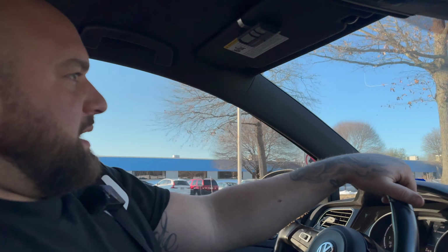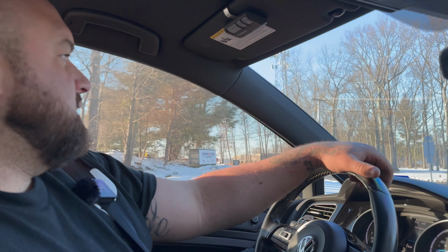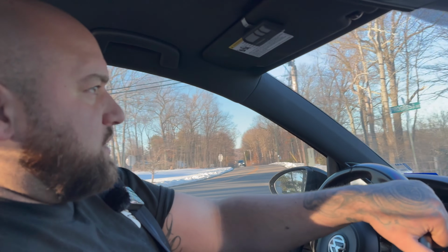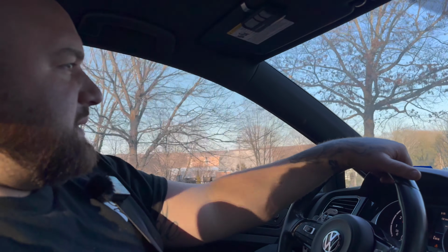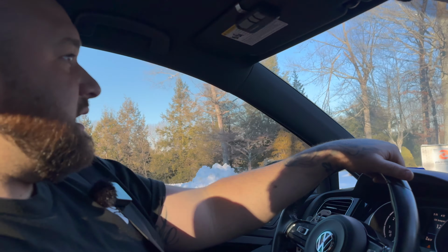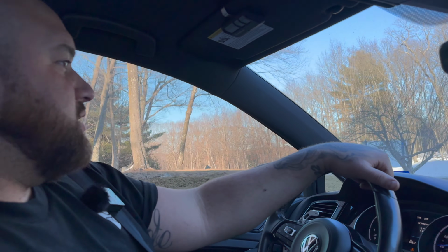The high-pressure fuel pumps on these, when you have the aftermarket piston in it, sometimes when it gets hot, the piston seizes up. Right on the last runs, Matt over at EQT said fuel pressure just is bad. So basically, EQT warrantied their part, got a part overnighted. Sweet. So we have a new high pressure fuel pump in there, and the new thermostat housing from FCP is actually leaking. So we got that warrantied, and I just finished putting a new one of those in.